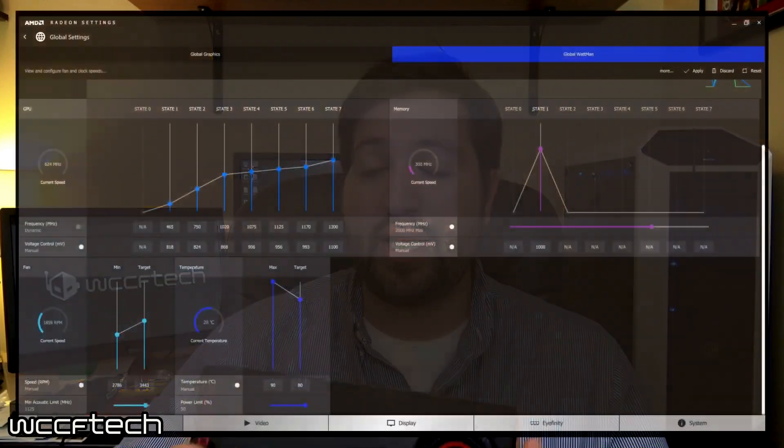The biggest drawback I have to point out is that even though the core is rated at 1226, it really settles around 950 MHz when left alone. It's easily overclocked, however there are limits because we are still looking at a 6-pin power connector. We were able to overclock it to around 1300 MHz on the core and 2000 MHz on the memory, with a plus 50 on the power limit and a little extra voltage — but not very much. That was kind of the limit for the card because it does have a little bit less power delivery than the RX 480.